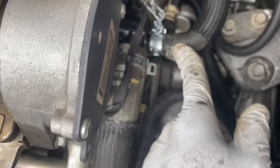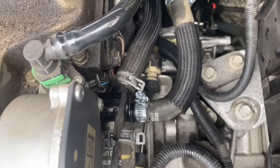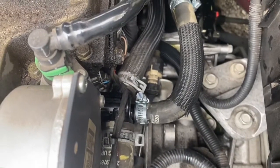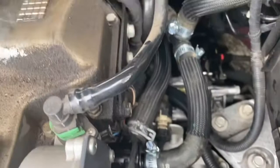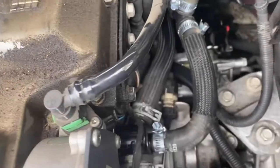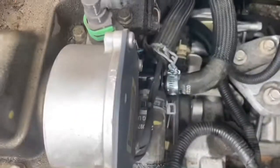In this case we had to replace all the clamps on here — this is a 2014 Chevy Malibu. A lot of times the old clamps don't seal right because of the heat, and those clamps will cause a lot of pressure buildup and then they start leaking on the ends. Sometimes you think you just have a bad hose, but it's actually the clamps that are bad. In this case, that's what it was, so we replaced all of them with new clamps.